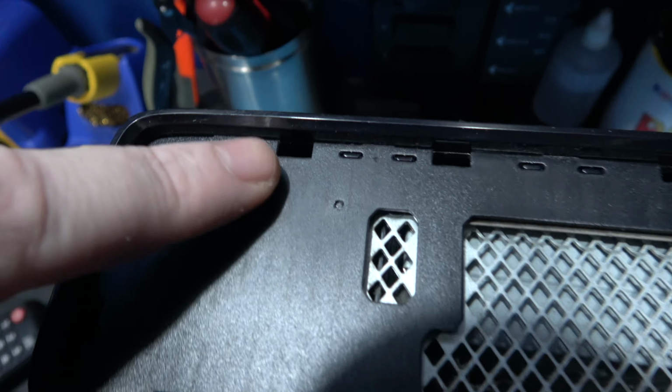Now, what I need to do is get two valid NAND dumps. You can see here, it's dumping it twice. It will dump the NAND once, and when it's done, it will dump the NAND again and compare those two images. If they're the same, I can continue. If they're not, I'll need to check my wiring and make sure everything's okay. But before you continue, you need to make sure you get two valid, compared, matching NAND dumps.